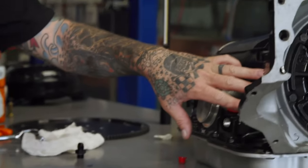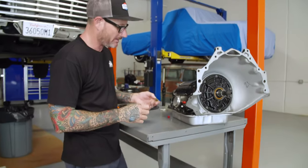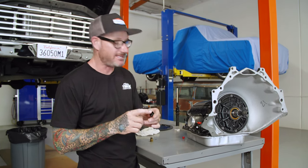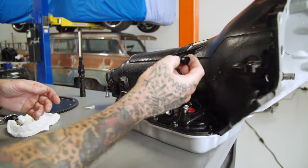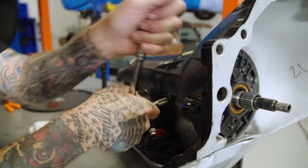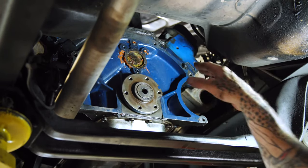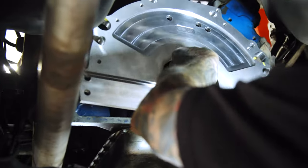We've got to put an oil cooler on this. The adapters that came with the transmission are 5/16 hard lines with inverted flare fittings. I want to do AN - I'm going to use an ORB fitting with an O-ring, size 9/16, to dash-6AN. These ports are tapped at 12mm, and I couldn't find a fitting that went from 12mm to dash-6 in the time I needed. So since they're already the right size, I'm going to tap them out to 9/16. I'll go in a little, back it out, vacuum it, go in a little more - that way I'm not getting any shavings in the transmission. Then I cleaned everything and made sure it was deburred so that adapter plate fits flush through the block.